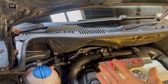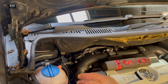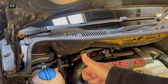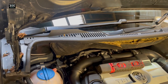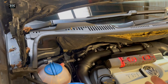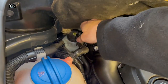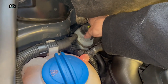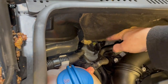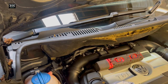Or if it does leak, make sure you rinse it afterwards. You can wash the area with water or brake cleaner. Sometimes the fluid is a little bit lower — as the pads wear down the fluid goes down, but sometimes people top it up, and when you top it up then when you push those pistons back it will come out. The main thing is also to open that cover and leave it just sitting there, because we don't want dust going into the container and contaminating the fluid.